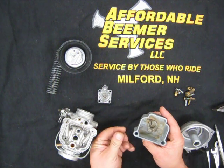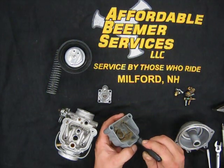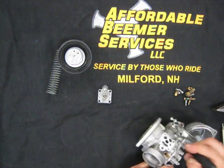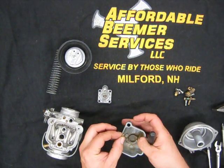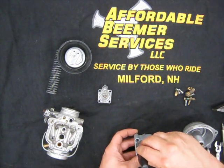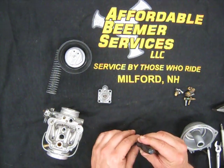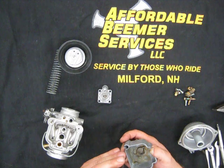One thing people frequently forget about in the float bowl is this small orifice on the bottom. This is the choke circuit. It pulls fuel from the bottom up this tube here into the choke. There is a tiny little jet that resides in this chamber in the float bowl. You need to remove that jet, make sure it's clear, and that this chamber is clear, and you can blow through it with a blowgun, and you get air coming out of this lower hole, or the opposite way. So now that I've verified that this jet is clear, we can put this jet back in the bowl.